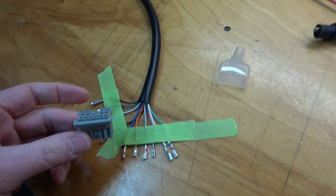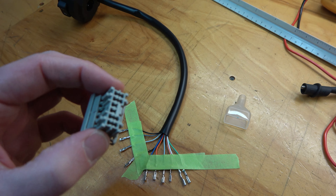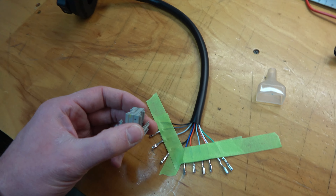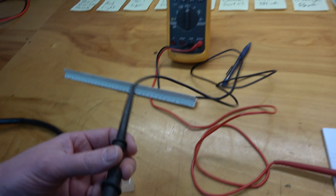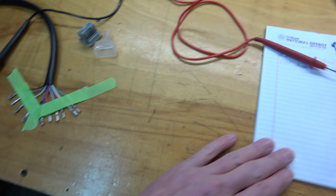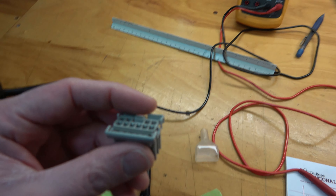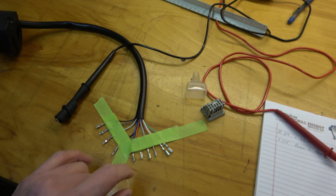Good news - I was able to de-pin the stock Honda control switch. I did a quick look online trying to identify the electrical terminal. I didn't want to just cut the wires in case I can salvage it - that'd be awesome because if it ever breaks I can just get another from the OEM parts finder and plug it right back in. I'm going to use a multimeter, clip onto one wire, manipulate the switch, and figure out what each wire does. If anybody knows what connector Honda uses on a 2020 CRF 450L control switch, that'd be great.